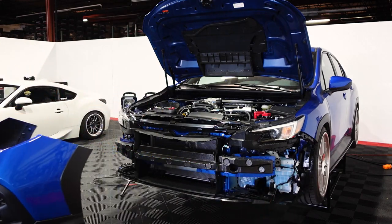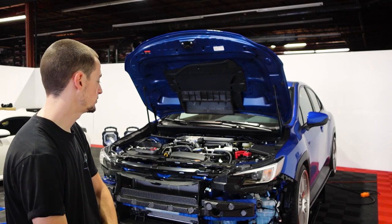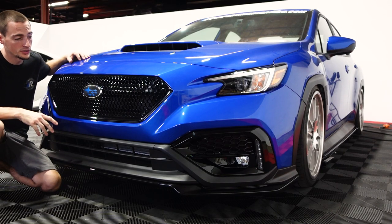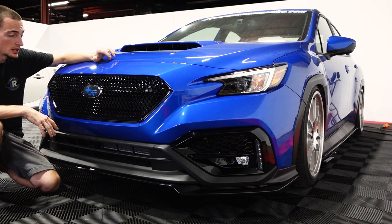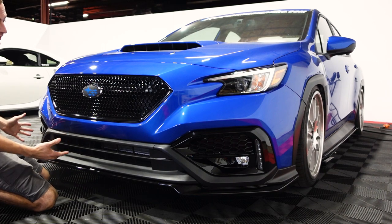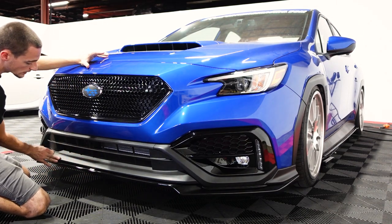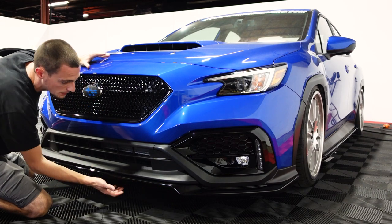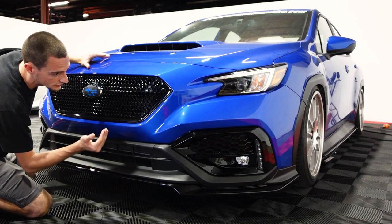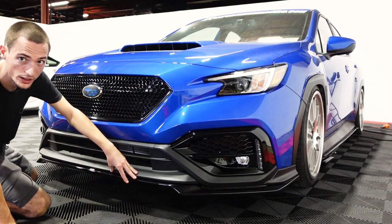You can do whatever you've got to do. To reinstall this bumper is very simple — we're just going to do exactly what we just did, just in reverse. It's not that hard to remove the bumper off your 2022 WRX. Now that you're masters of removing your front bumper cover, here are a couple quick tips on reinstall. If you have any difficulties, start by putting one of those pop clips back up at the top so you can line up the sides without the bumper falling. If it seems like it's caught on something, odds are it's caught underneath — there's a little tray that runs underneath that allows air to flow into the radiator and AC condenser, and that tray sometimes gets stuck. Once you're under the bumper, you'll see the tabs and where they have to go underneath that tray.